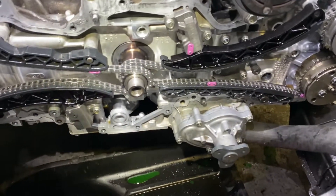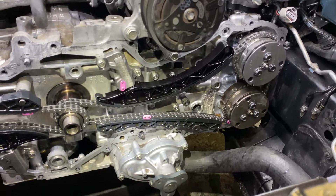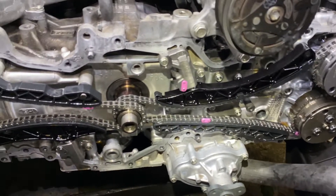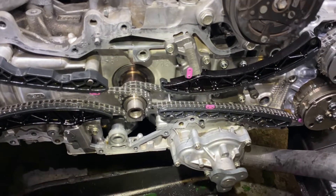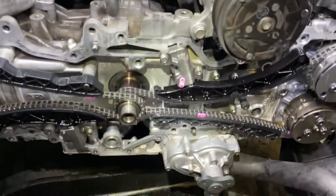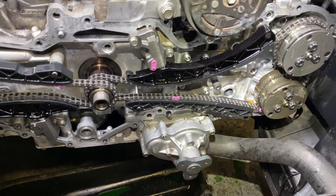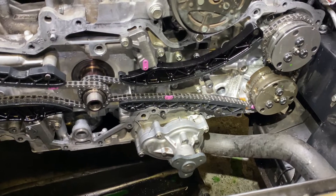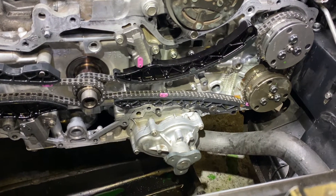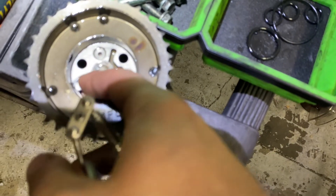If you have any questions, leave a comment. You will be able to identify the actual problem based on the readings you get with the scan tool, so make sure you're checking that before taking everything apart so you know exactly what needs to be replaced. I'll put in the description what the specs are, because that was another way we diagnosed it — one of the actuators was actually out of spec. We also noticed on both old actuators, the pieces in the back here were loose and almost missing.